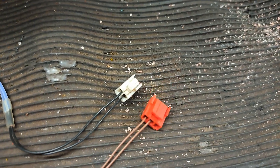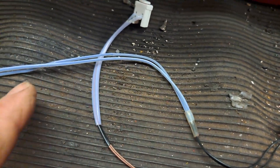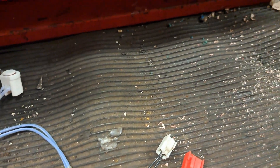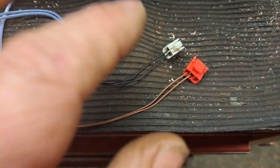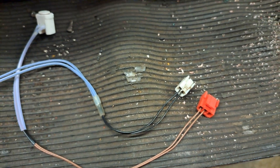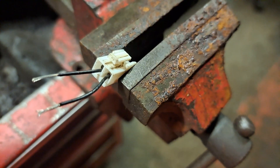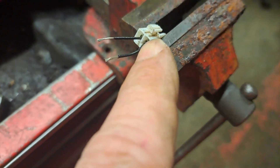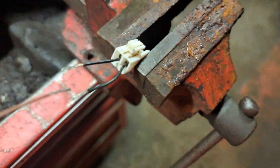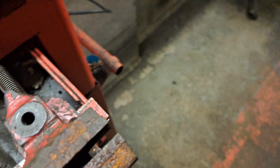What I'm going to do is cut the wires - I don't think that end's got the heat shrink on for the temperature sensor and this end's just normal - so I'm going to cut it about a quarter of an inch from the end, solder it up, and insulate it. That's the only way. I've got the connector I need in the vice, I've bared the ends off, I'm just going to tin that up and solder that one on and then the other one on the other side.